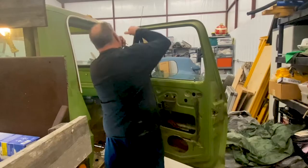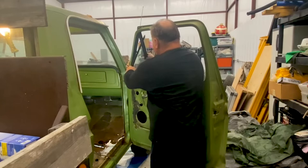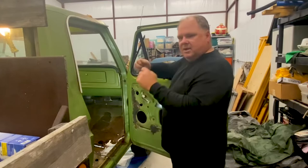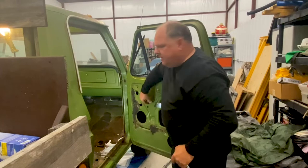There are three Phillips head screws that you're gonna need to take out, so we're gonna start by doing that. Go ahead and open up your vent window so you can get access. What's gonna happen is we're gonna remove this one bolt down here, this whole piece will then pull on out. But to get it out you're gonna have to remove this trim first, then the glass will pull out because you have to shimmy this bottom piece out with the bracket. The 7/16 socket handles the bolts that hold the mechanism that moves the window up and down.